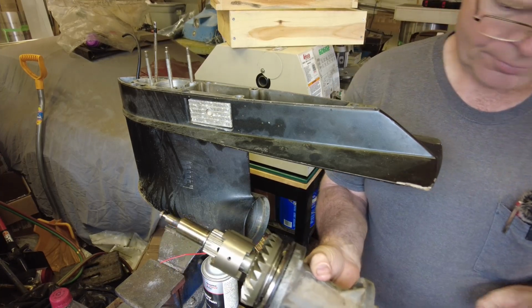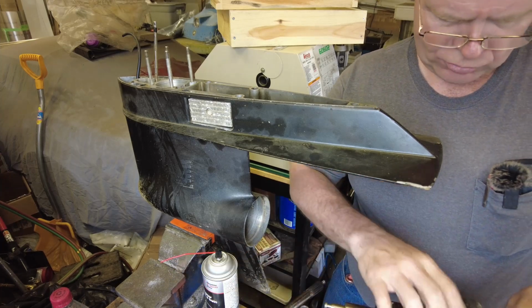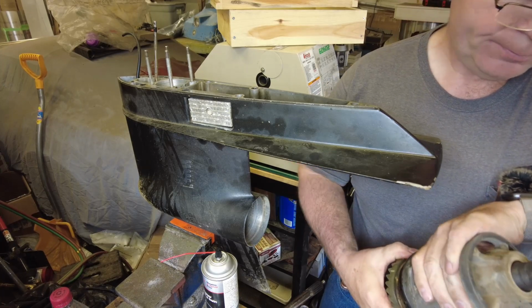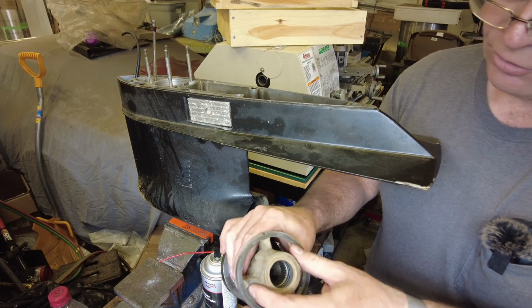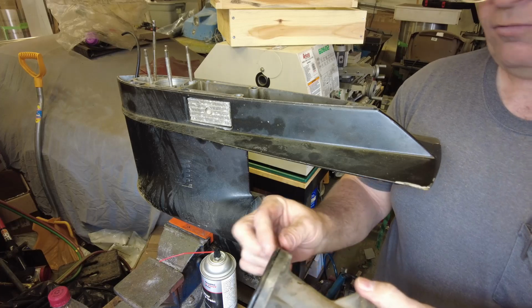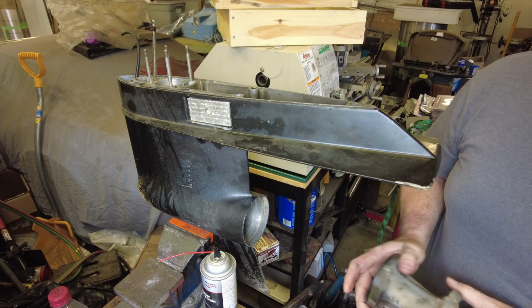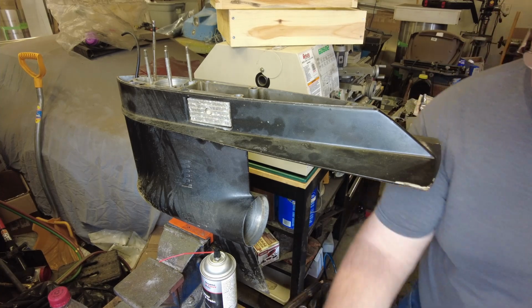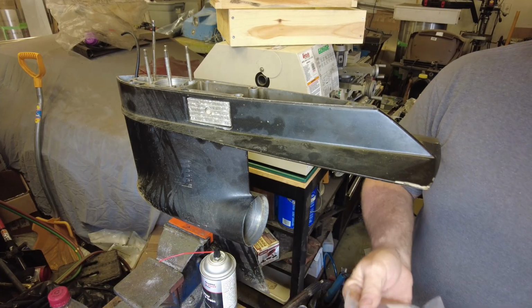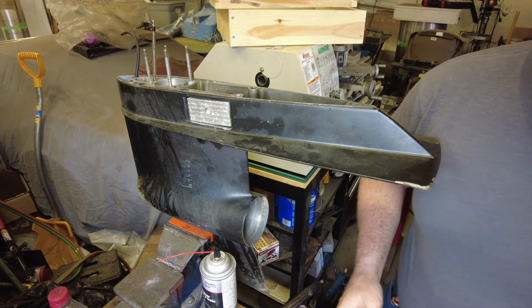We need new seals installed, because basically I think this whole issue was caused by bad seals. In the end of the spool piece, this goes in like that. We've got an O-ring here. We've got two lip seals that are there. I guess we should take a look at the seal kit that I got and make sure that that is the right one. Make sure we got the right parts before we start ripping things apart.